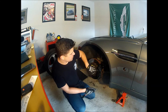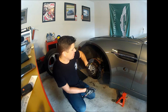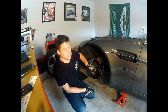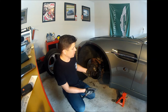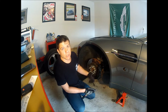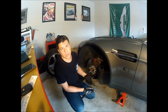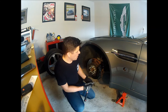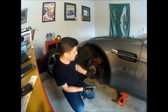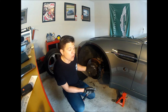Something to notice before I start: you'll see that some of the clear coat on the brake calipers has flaked off. I don't know if that's common for most Aston Martins, but it is on mine because I track my car and drive it pretty hard — the brakes get really hot and that causes the clear coat to deteriorate. It's not hard to fix but it is labor intensive because you have to pull the calipers off, which means bleeding the brake system and removing the caliper. However it's just cosmetic; I haven't had any rust issues on the caliper underneath.